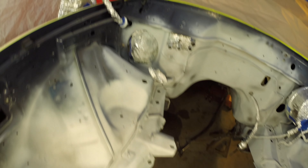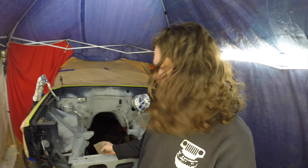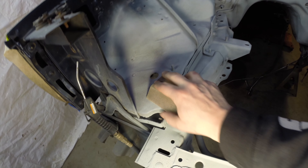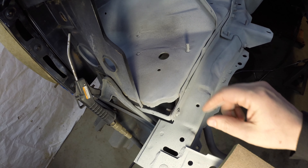Here's what we got. We got primer down and then I went through and sprayed a guide coat. What's a guide coat? It's a thing I learned about on the internet — apparently it seems like a pretty good idea. You take a spray paint can and you spray just a little bit of paint color on top of the primer. And so when you're sanding the primer, you can take your hand and wipe and feel the difference. But if you take your sandpaper and sand an area, the guide coat goes away. That's a neat idea.